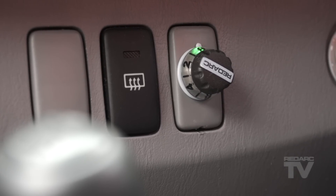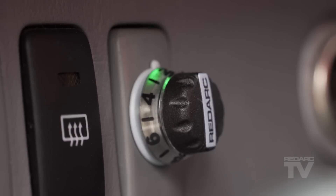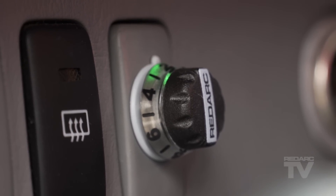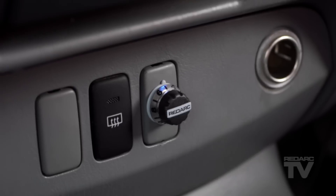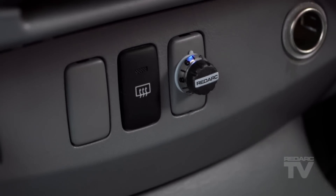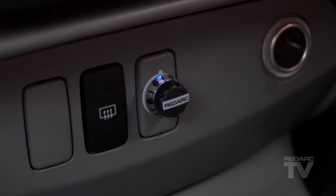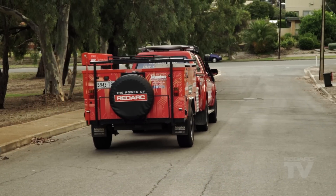This is indicated by the LED glowing green with blue flashes. When the foot brake is applied, the LED will pulse green and red. As the TowPro Elite becomes more confident of its direction of travel, the length of blue flash will increase to the point where the LED is solid blue, which indicates it's now operating completely in automatic mode.